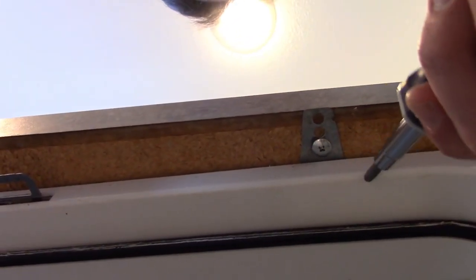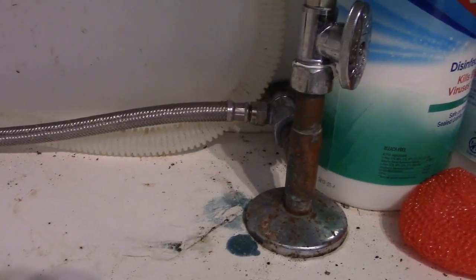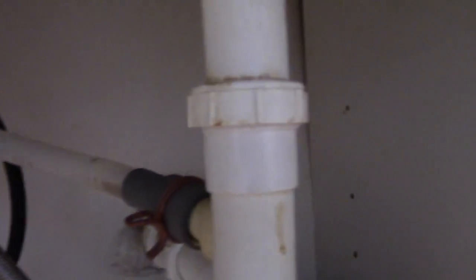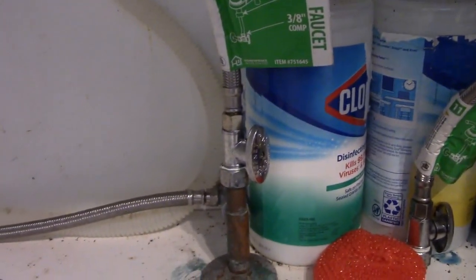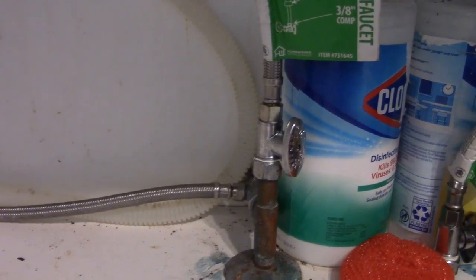Chris, I couldn't imagine how to get it out. Of course you can — it's just one screw right here, and then the whole unit should pop out. But you do have to disconnect the water and the drain line. Right here is where the water is, and that's where the shutoff valve is, and the drain line comes right there. There's probably enough slack that I don't even have to do that, but I'll at least shut off the water and check for tugging. I think there's enough play to pull out the unit.